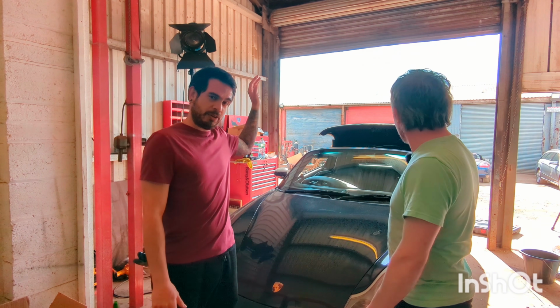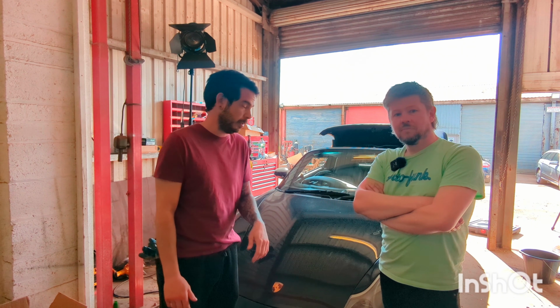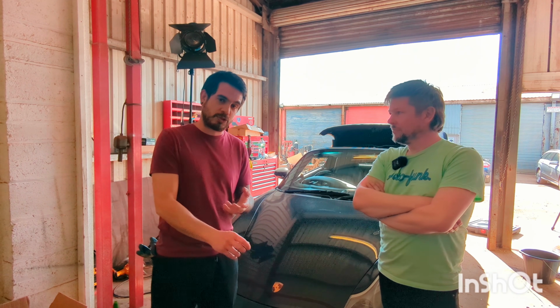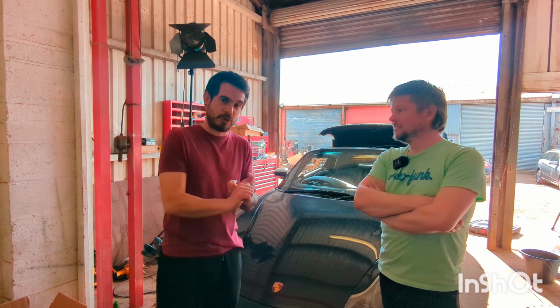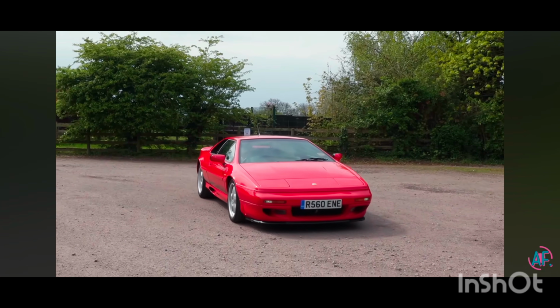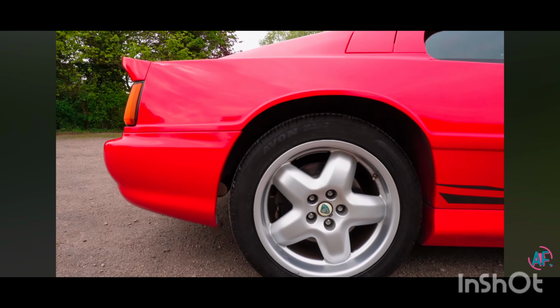Fundamentally, we're going to go have a look at doing the water pump, the sender unit, the thermostat, which there is a full DIY video on how to do this on a 986 in the comments below. On another subscriber's car. We're going to be looking at a new belt. We're going to probably be looking at sorting out some few little tricky issues with some of the ignition coils. And we're going to show Mark a little bit more about how to work with and access bits of this car.